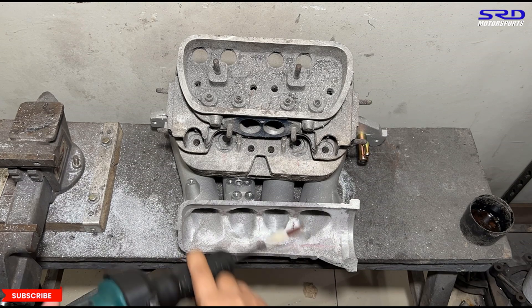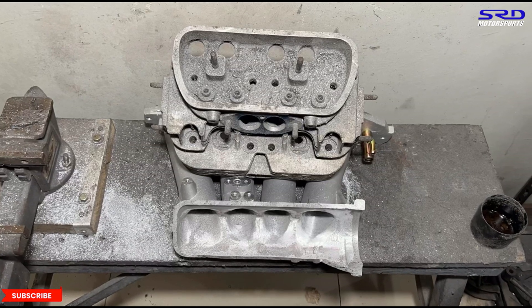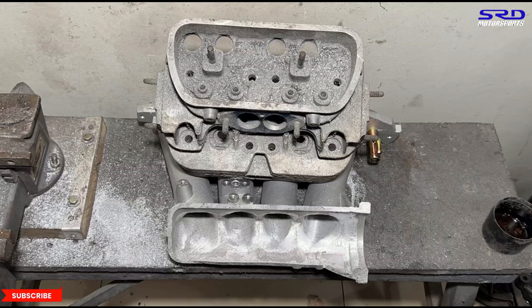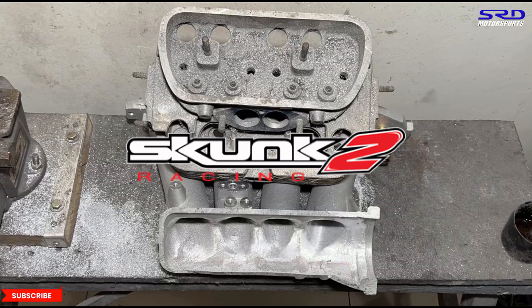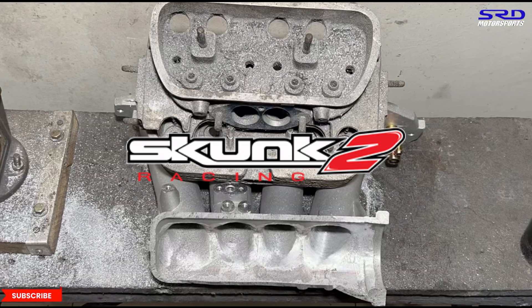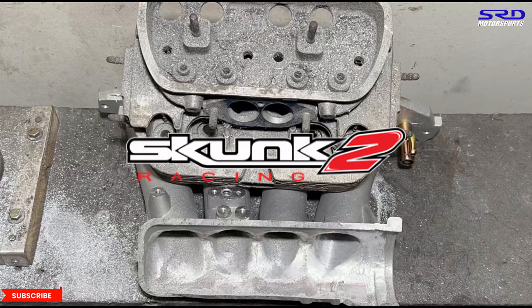This is the fun in porting intake manifolds. As you increase runner taper, there's a good chance you turn up the volumetric efficiency higher or better. This lets you run a bigger cam without losing much midrange. In some cases, that could actually help a lack of compression — because with runner airspeed faster, that solves that aspect a little bit. That is why when you have to build an engine that lacks compression, if you would just let me port the intake manifold, that's not going to be a problem.